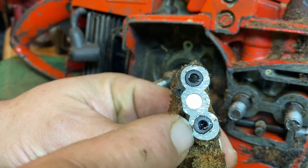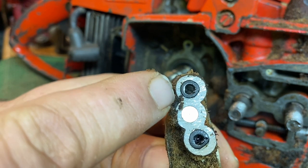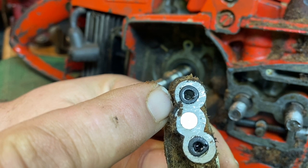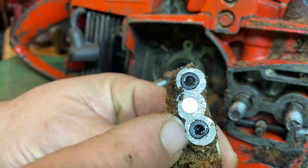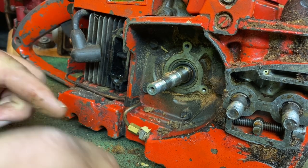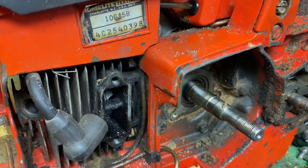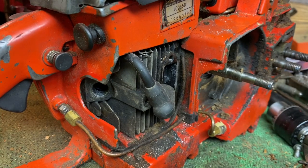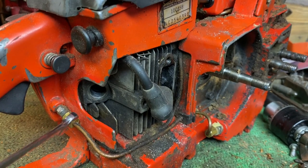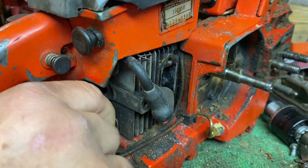You will notice the pump has two O-rings. You can see one of the O-rings is deformed, and I'm going to replace both of these O-rings before I reinstall. Now I'm going to get into starting to remove this oil line — very simple. It is a 3/8-inch fitting and it's very simple to remove.